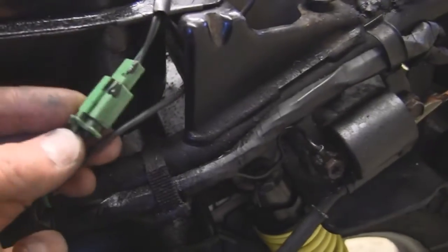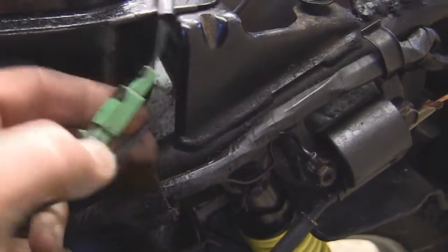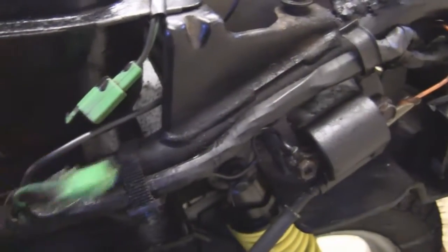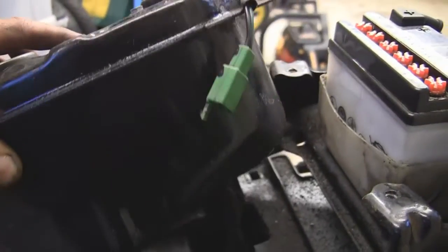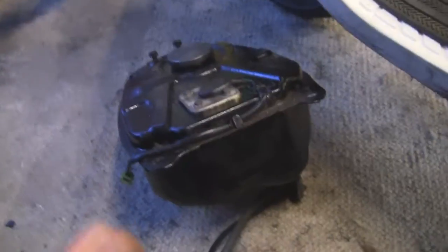There's also this little connector to take off — basically very simple, just a little clip on here. Push that, undo this wiring. Hopefully this tank comes free now — just pull it up, keep an eye on the fuel line and pull that out as well. Just lift it off the bike. There we go, it's off.